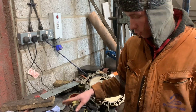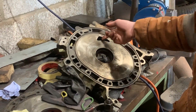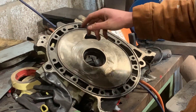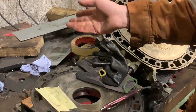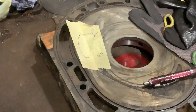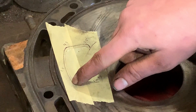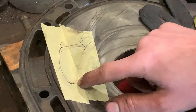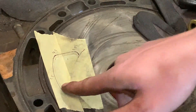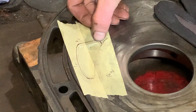For the secondary ports, there's a lip here and a lip here as well, and it's not that great — especially on this one, there's some sort of line. I don't want to go too extreme but don't want to go too mild either, so keeping it the same approach as the other ports. The plan is increasing by 1.5mm here. I'm not going to do anything before I take the mask and tape off so I can properly blend it in. Here I'm going 4.5mm and here going 3.5mm.